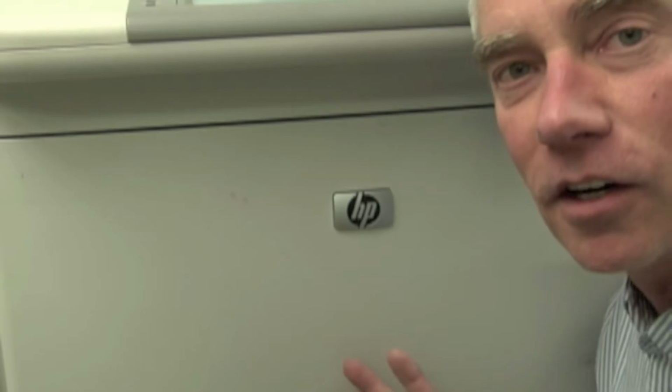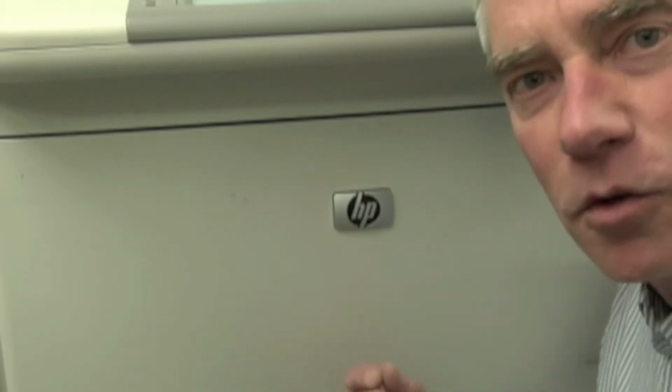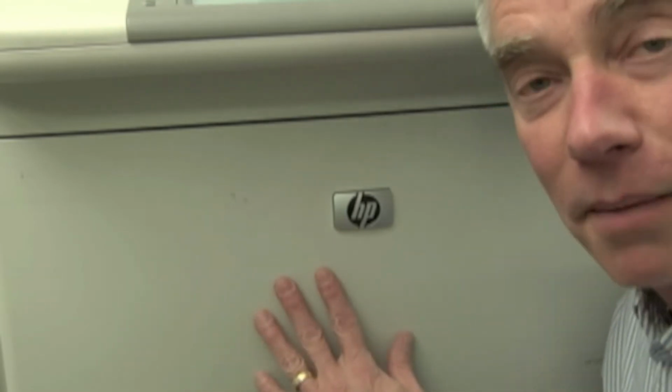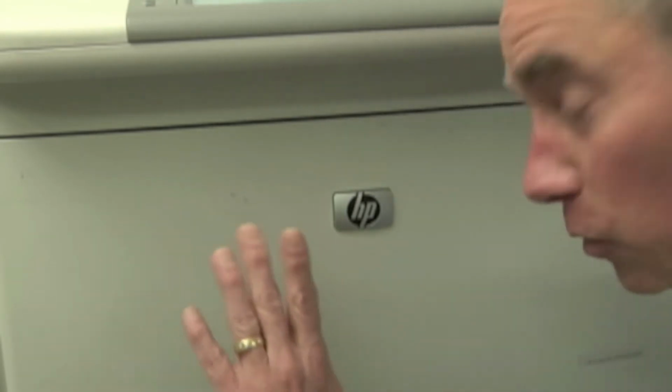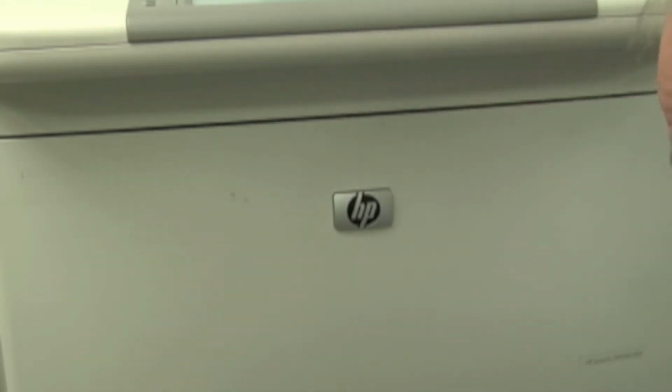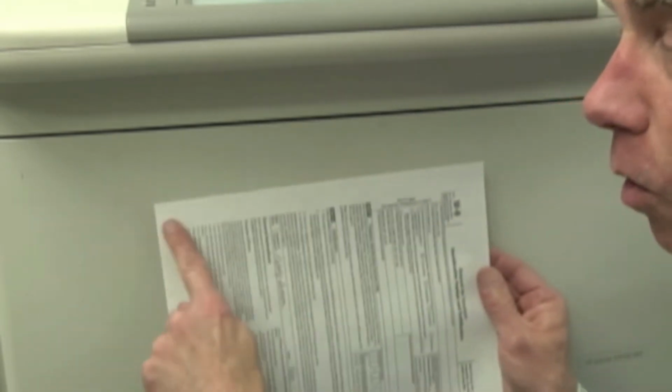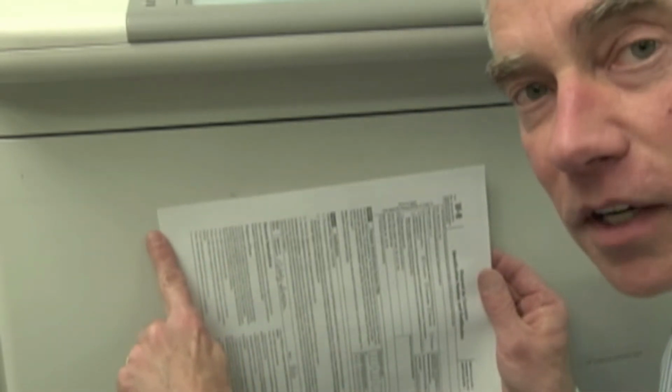And what we have here is a situation where we have a problem with the feed guide in this one, where the feed guide is popping out of position, causing an image defect. The image defect tends to show up here, standard piece of paper, with gray shading up in one of the corners here on the right side or on the left side is where it tends to appear. What is going on here? Well, let's dig into it and find out.